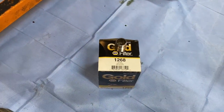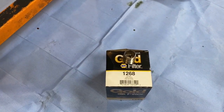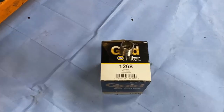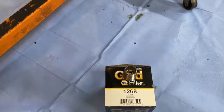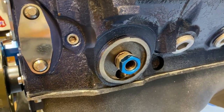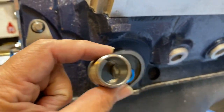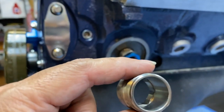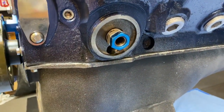I'm going to use Tim Meyer's Trek Boss Performance oil filter adapter, which adapts the Napa Gold 1268 instead of using the old Ford 515. This will replace the regular Ford adapter. If you look at the difference in size you can already see there's a big difference. Whether that's going to make much difference in pressure, just the volume alone of the filter will make a difference.